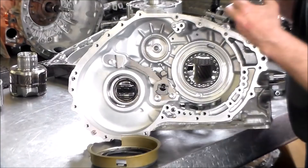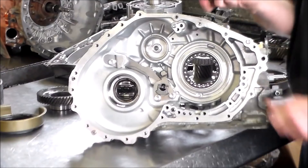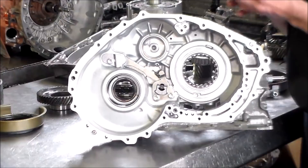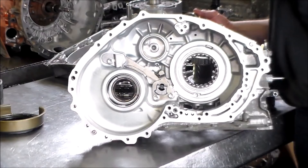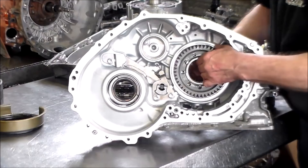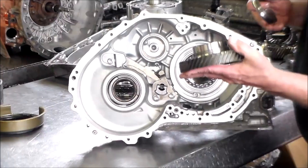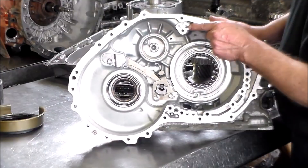After the piston is in, you can put the gear on. Then you have this planetary — this is the one big planet here — and it takes a big gun. I have the nut and the spanner socket coming. You have a race here, another race, one that goes here, and then a race that goes into the back. The race for the bearing has to go in first — when you press this out, it's going to fall out, so be aware of that.